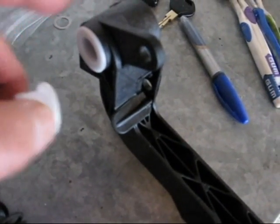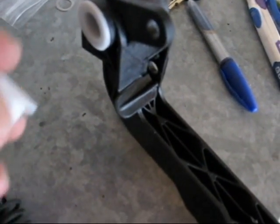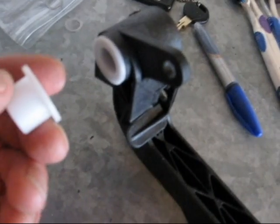There was no rounding out on the pedal or elongating, so there was no need to replace the pedal. If these don't slide in really nice, then you've got wear inside the barrel of the pedal and you'll need a new pedal. I'm going to lubricate this — after I get these two in, I'm going to lubricate in here and on the shaft that this will rotate on with some white grease. UUC says to lubricate it, but it doesn't say what to use.